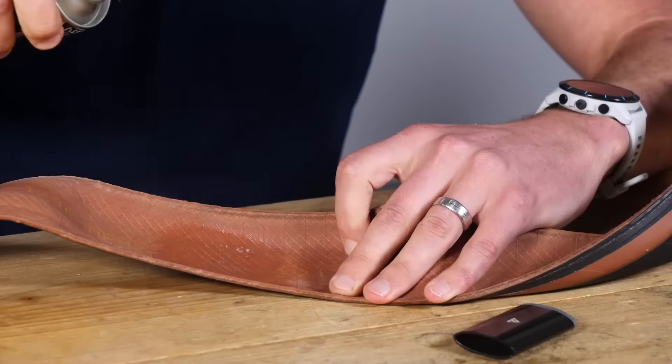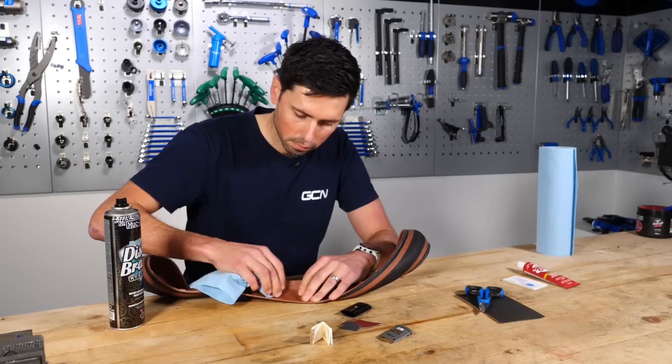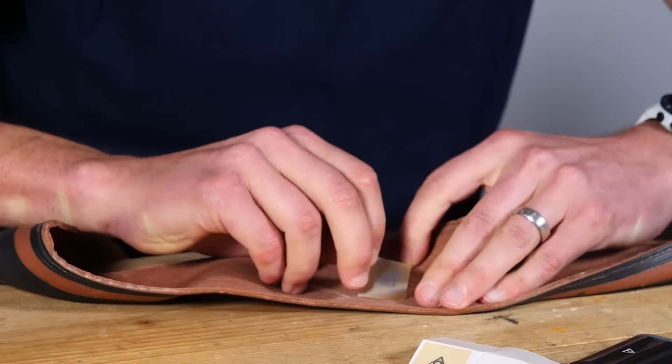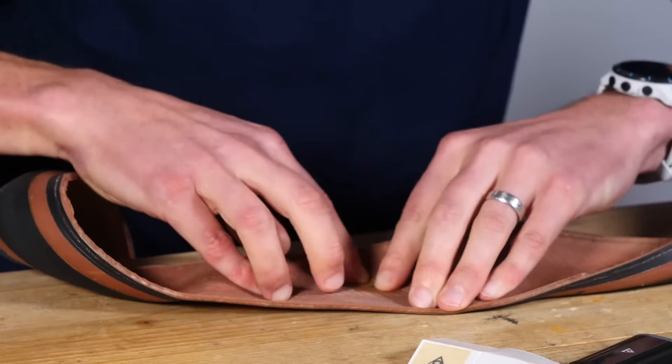I've done it in the past. Technically it's going to put the wheel out of balance, but we're talking such a small difference here, and the fact it wasn't perfectly balanced in the first place. What I would say — be mindful of is the size of the cut or hole, as a normal inner tube patch on the inside of the tire might not be strong enough. But you can always patch it and run it tubeless, or patch it and run it with an inner tube in.